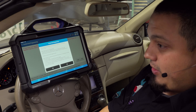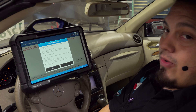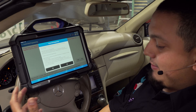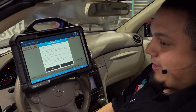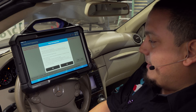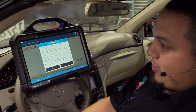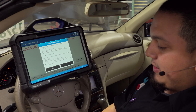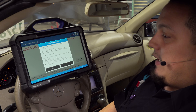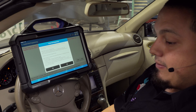There's risk involved in any programming event — it doesn't matter what you're working on, there's always going to be some kind of risk, more so when using aftermarket tools. But we have ways to recover the ME module if it comes to that. When I first got into programming it was like a giant veil. The first and only time I ever bricked something was with a BMW — I did everything to the T with factory tools, and it was recoverable. There are times where it won't be recoverable.